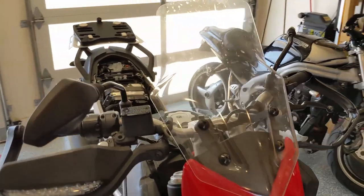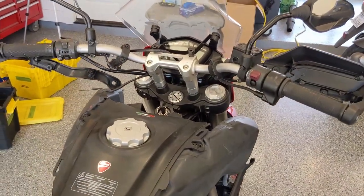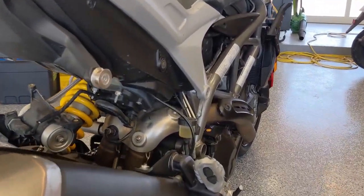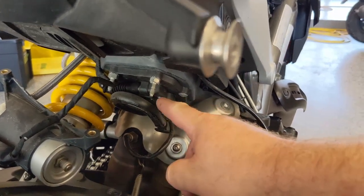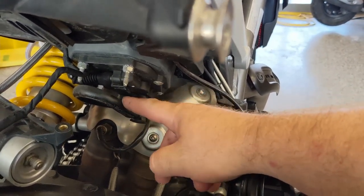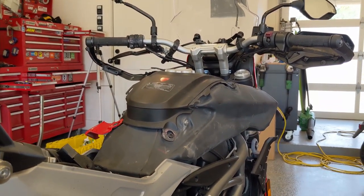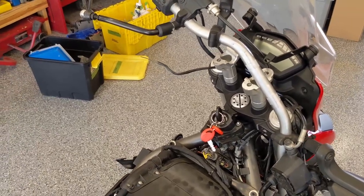When I got this, the gas tank was up on top of the handlebars and I had to actually remove the handlebars in order to get the gas tank down so I could turn the handlebars on the bike. As you can see it stretches all the way underneath the seat. There's a cap under here held on by three screws that gives you access to the fuel pump, which is mounted in the bottom of the tank. At a minimum we need to disconnect this electrical plug and this quick connect in order to remove it, then pull the gas tank out.